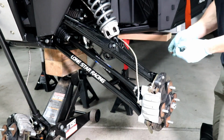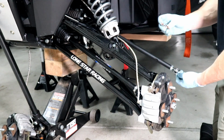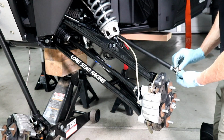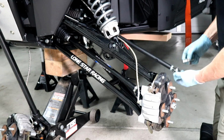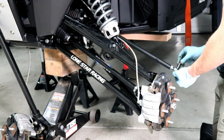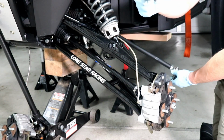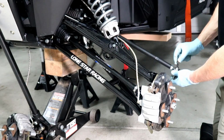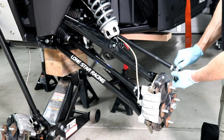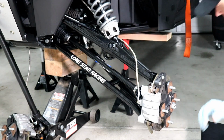It's kind of hard to show this on camera, but for the tie rod, you've got this little cap top piece that's going to fit in there in the heim, and then your main piece, again, don't know the name of this, sorry, technical term, is going to come in from the bottom, and then you've got the nut that's going to thread down through that top cap. Get that tightened down. Looks to be like 5/16.